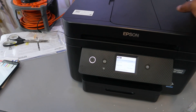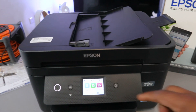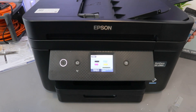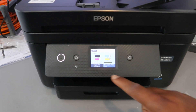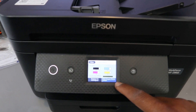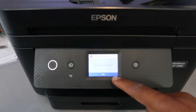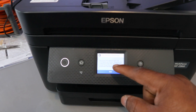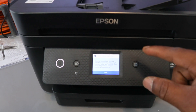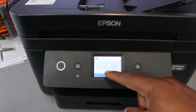Now I want to show you how to replace the ink cartridges. Go to the ink image on the screen and select it. You will see options for 'Replace Ink Cartridges' or 'Print Supply Status Sheet.' Select 'Replace Ink Cartridges,' then select Next. Remove and replace each ink cartridge promptly — delaying insertion of a new cartridge may cause the printer to perform additional maintenance. Then select Start.